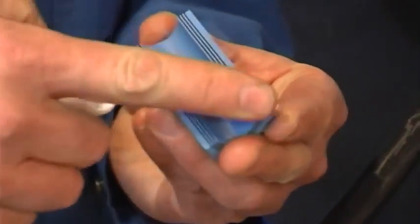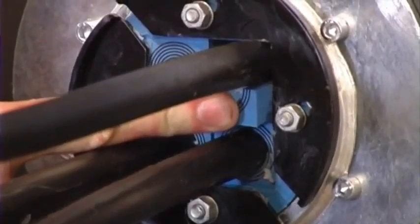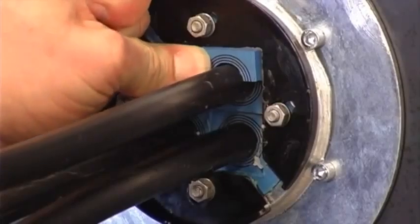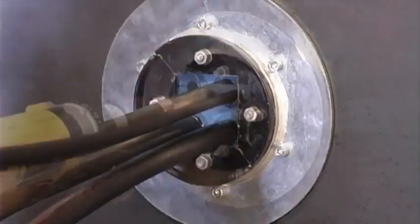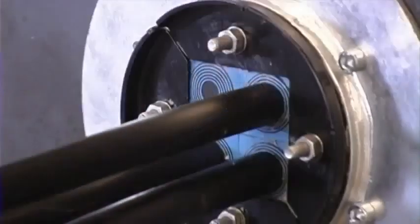Adapt the module to the right cable diameter and make sure that there is a 0.1 to 1 mm gap. Lubricate thoroughly and then reinstall the module. Push the fittings back towards the center of the frame and tighten the nuts until approximately 10 to 12 mm of thread protrudes.